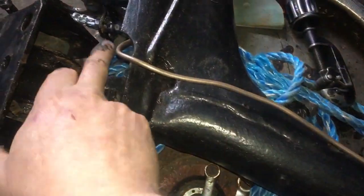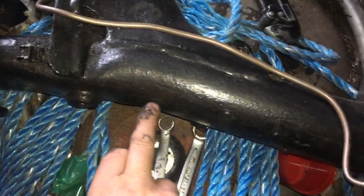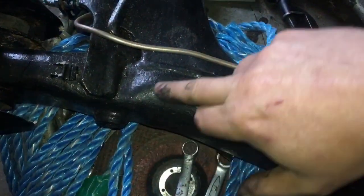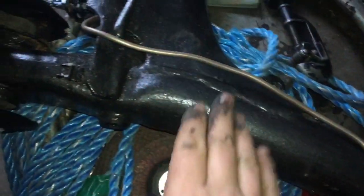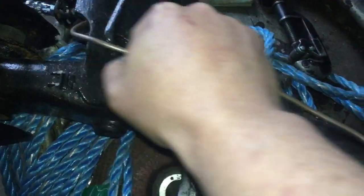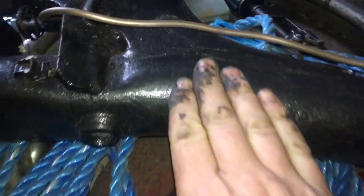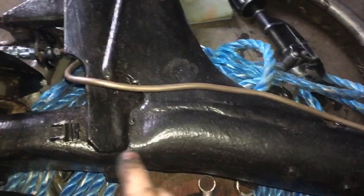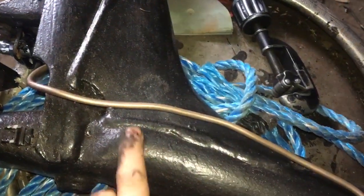So I think normally they come out this way and they come down the side, but the problem with that is, yeah, they sweep around like this or do something like that, but just about here the chassis leg is actually running here, and so when it's going up and down, it'll more likely crush the pipe anyway. So that's why I don't like going over this.